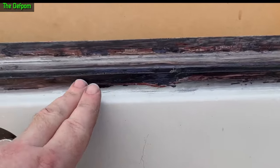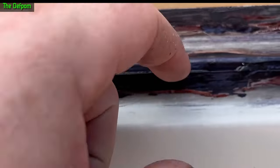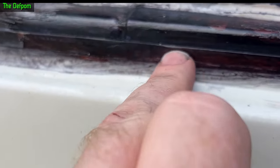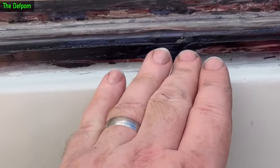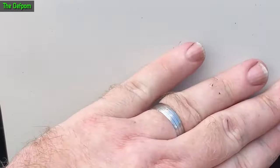On the side of the bus here there's previous damage which has been repaired. I've dug out all this seam that's been done, rust treated it so it's all blank, put rust treatment down the whole thing, wire brushed it as much as needed. There's a seam here with a little opening where it's actually tack welded. Over here there are also tack welds - repairs done in the past from rear end damage. Right here is a panel edge and right here is a crack in the paint - there's a seam there and that's where it's cracking. I think water's got in and run down the side panel. There's lots of filler here - obviously smoothed out and blended in - and I think there's surface rust behind the filler which is why it's cracking.